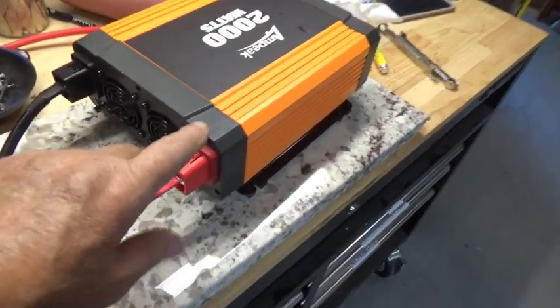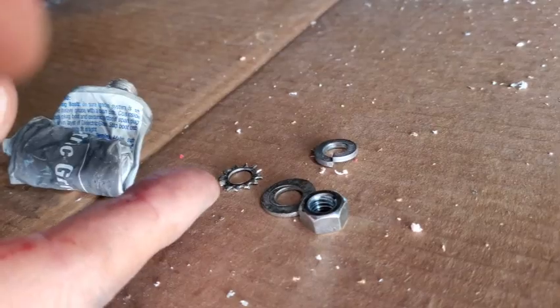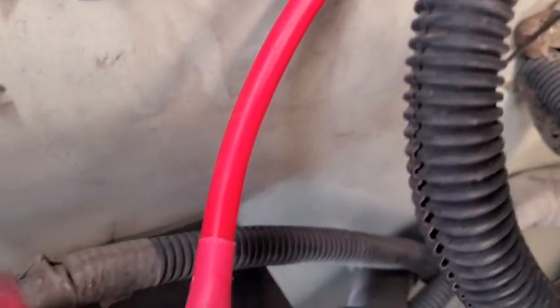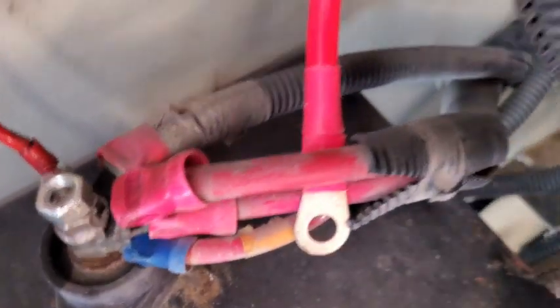Here I am under the vehicle. There's the grease I'm going to use, and the nuts, bolts, washers, and everything. For the ground, I ground that off with the grinder so it's got a good ground right there — that's where the ground wire is going to go. The red wire is coming through here and going to hook right to where all the other battery connections for the complete unit go. We're going to hook up positive first and then ground, then come back and fill all the little gaps with silicone.